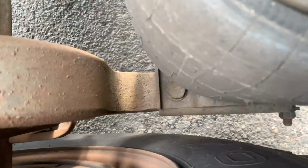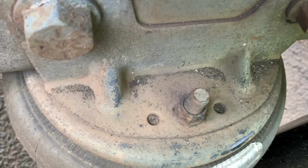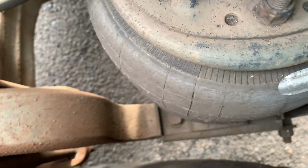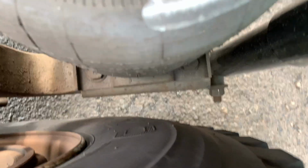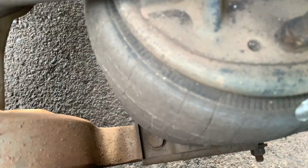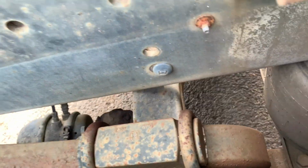And it drops down on the back. And I have an airbag, the top bracket, nut and bolt present, bolting the airbag to the frame. The drop leaf spring goes to the left. The bottom of the bag, the nut and bolt present, they're tightly bolted to the drop leaf spring. Then I check for bent, twist, crack. The bag is rubber, no cut, crack or tear, no hole, no leak.